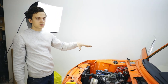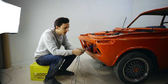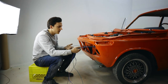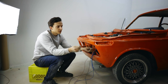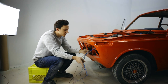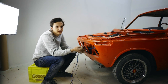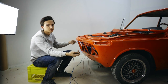With that run, we can start doing some of the end connections on all these wires. At the front end we've got our running lights, left signal, right signal, high beams, low beams, and the horn. The running lights wire only powers one side, so we need to splice into it to send power to the other side so that both running lights are on. We also need to do that with the low beams and the high beams — we need both to be on when those wires get power. The only ones we don't do that to are the left and right signals, because if you're signaling left you don't want your right signal turning on — those just go to their respective sides.